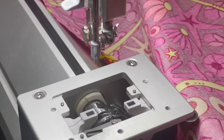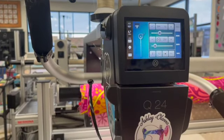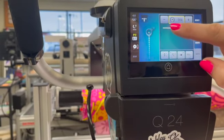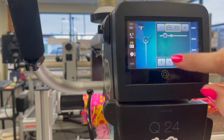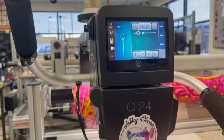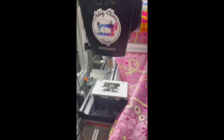If I've been running the machine for a little bit longer, sometimes I might do a little more oil. So I've put oil in the bobbin area, I've taken the foot off, and I've taken the needle out — that's important. Then I'm going to go up here to manual mode and turn my speed down somewhere around 500. Then I'm going to run my machine with no needle, no foot, no stitch plate.